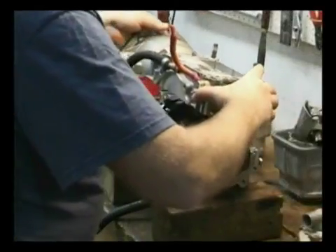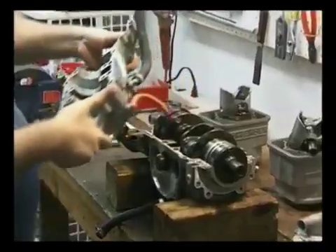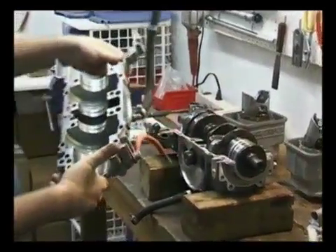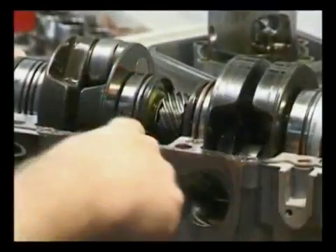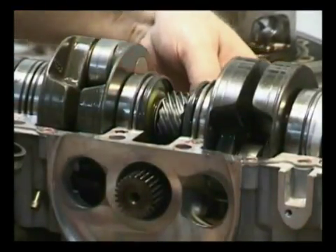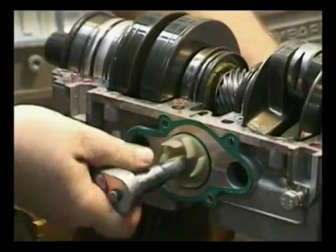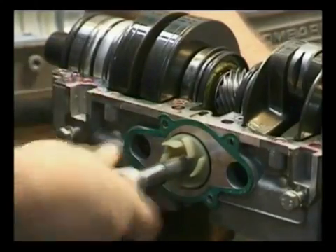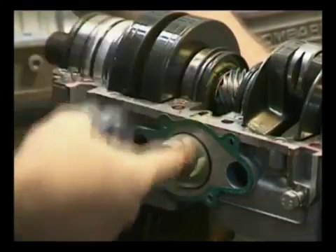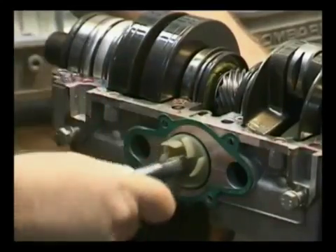What I'm going to do here is take the bottom half of the case out. Look how dirty it is — this turns the rotary valve on one side and the water pump impeller on the other. All I'm trying to do is take this nut off, because once you take the crankshaft out, the whole shaft will spin and you have nothing to stop it.